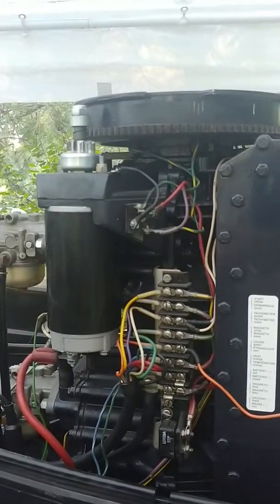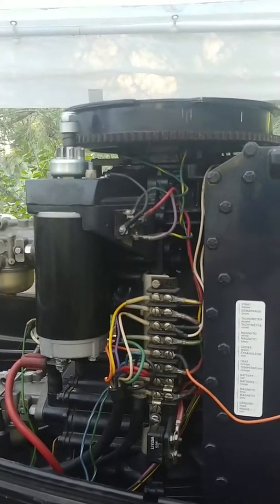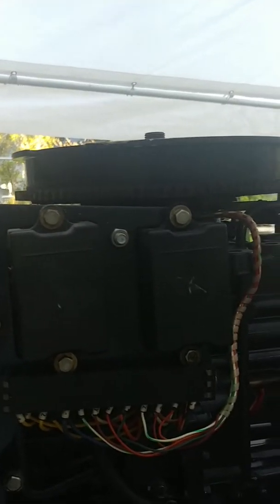I mean, you can hear other noises as well, but that's pretty much been it since I've had this motor. They're not very well insulated since they don't have much of a water jacket. I've had the head off, the port covers off, the whole reed valve assembly off, and looked in, and while I had it apart I've had the flywheel off. I gave it a little bit of moving around with the flywheel to make sure nothing made any clanky noises or sounded like it was loose. Everything seemed tight.